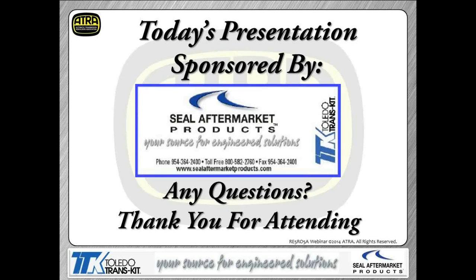Now, some guys are saying that the center support rings are giving them problems, and they're using rings cut to size from a 4L60 servo. I personally haven't had that problem, and I've talked to a few remans that are just using the OE or the aftermarket rings and not having an issue there.